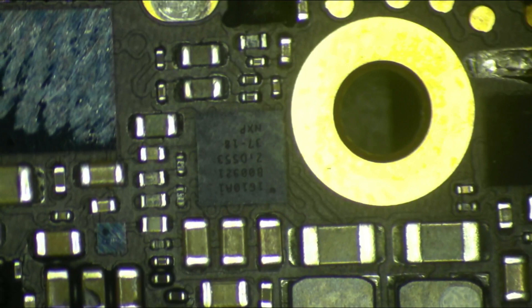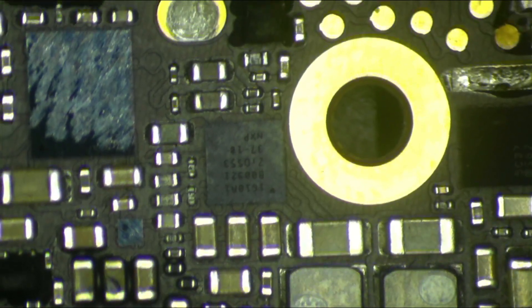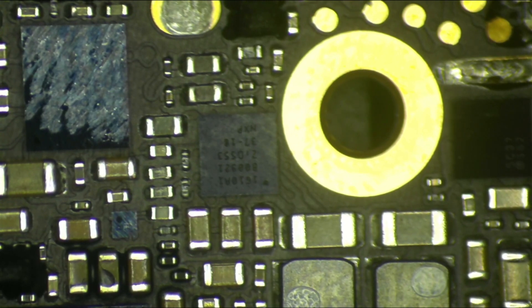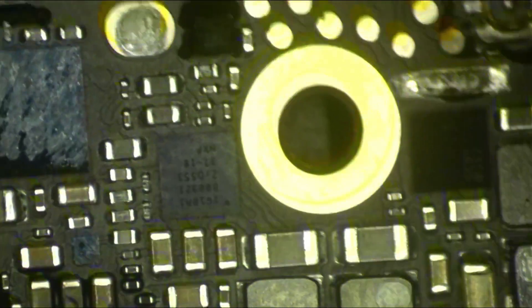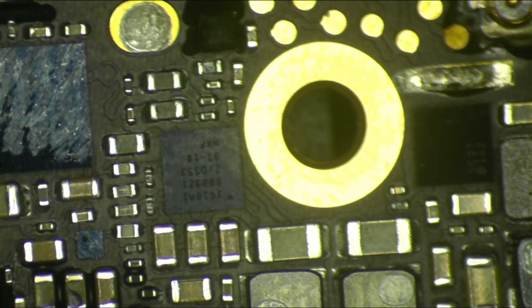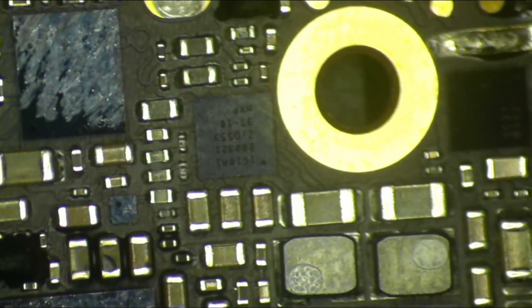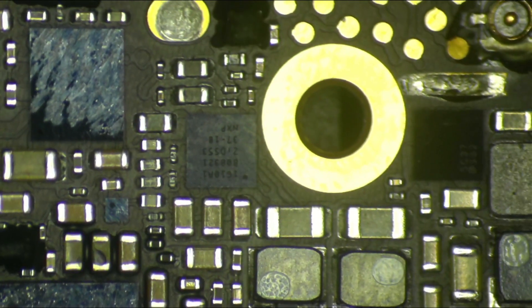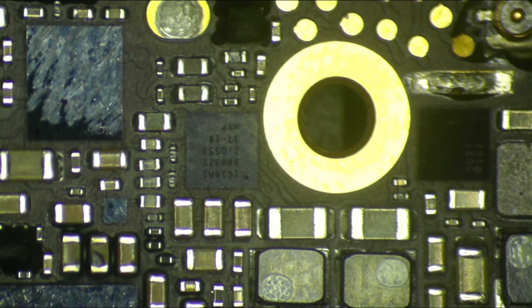I think he's our issue. I'm not going to go into this one too much — it's a data recovery — but the way the phone's responding, it's drawing 20 milliamp just with everything disconnected except for the charger. So 20 milliamp is not ideal. I haven't worked on many 5Ss. I didn't get into repairs until the 6 was pretty prevalent and forward. So I don't really know, but let's give it a crack anyway.